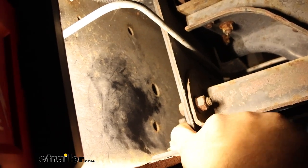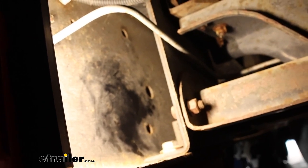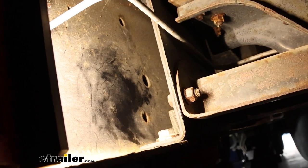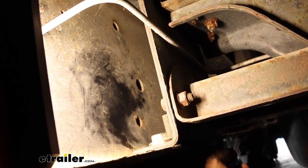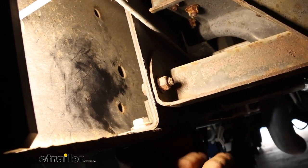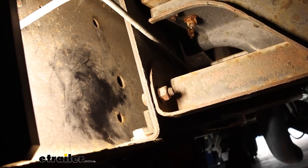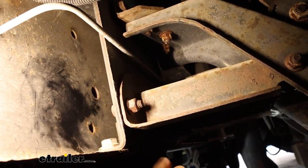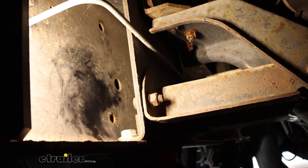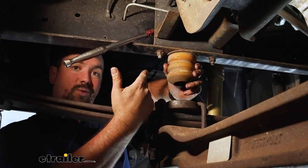The jounce bumper is secured by a 15-millimeter nut on the stud, and this is going to be in your frame rails. The passenger side is going to be a little bit easier, so you might want to do that one first — the only reason is because you have hard brake lines on your frame that can get in the way of the socket. This just spins on that nut, so if you can get a socket on there — it's going to be a 15-millimeter or even a wrench. It is slightly recessed, so you are going to need a deep well socket to go over that stud. If you can use the frame rail to keep that wrench in place, you should be able to just twist the jounce bumper and it should get loose. You can put a little penetrating oil if it's rusty.